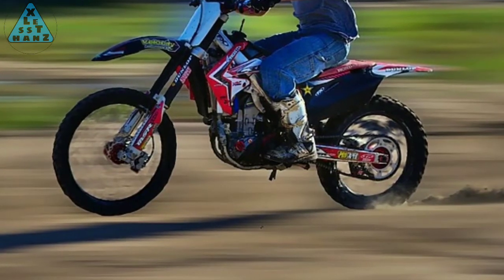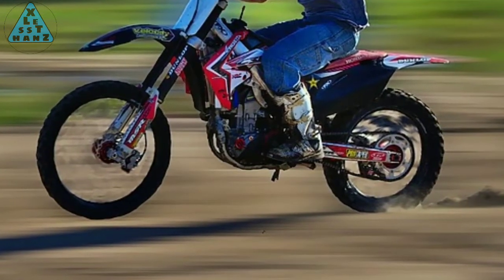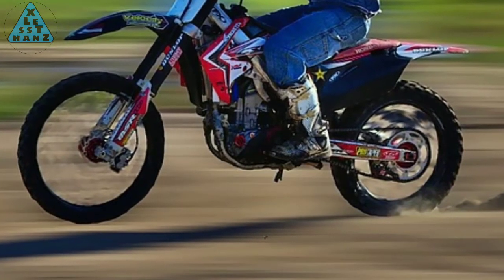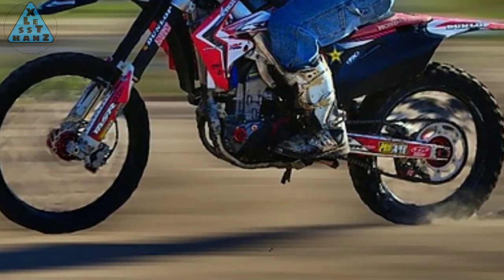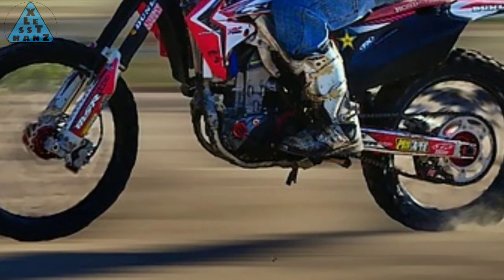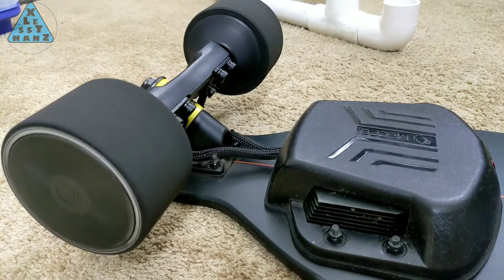Looking at the dirt bike again, you'll notice the front wheel diameter is larger than the rear wheel. The reason for this, along with help from the shock absorber, is the larger front wheel helps provide stability and control over typical motocross terrain. On the other hand, the smaller rear wheel helps with torque and power, with a smaller motor than would have been needed if you had used a rear wheel the same size as the front. With that in mind, I'm guessing the size of my Meepo's rear wheels are just fine for the electric motor it was designed with, so I won't be touching that in this project.